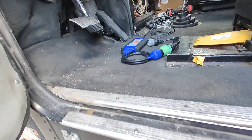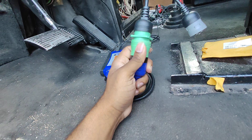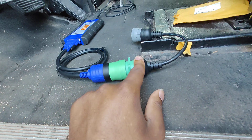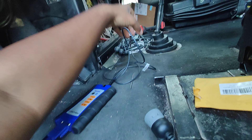At first I just had this part right here — it disconnects right here. It's a 9-pin connector, but this is a 6-pin connector, so I gotta adapt it from here to here. It goes from 9-pin to 6-pin, as y'all can see. That plugs in just like that, and then it's USB — you connect it to the laptop right here. Then I got the Detroit diesel calibration tool.